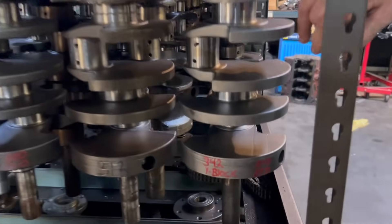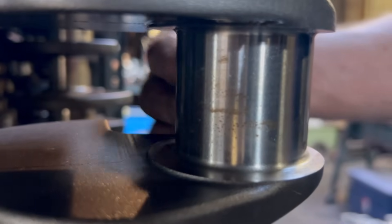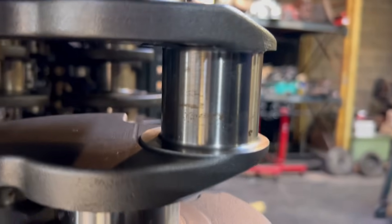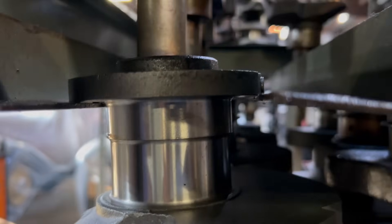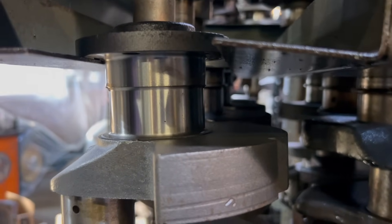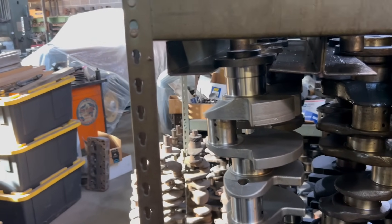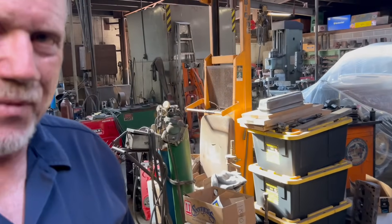If you zoom in real close and look at that, you can see the height of the thrust and how it is on the backside — you can tell that journal has been moved out to a longer stroke. This is a stock crank next to it, so you can tell this one hasn't been ground. You can see the lines and tell the difference. This one has been ground but not polished — it's been hanging on the rack a while and has a little bit of flash rust. Talk to us, Tim, about having 312 cranks ground down to 292 standard mains and everybody's concern over the slinger.